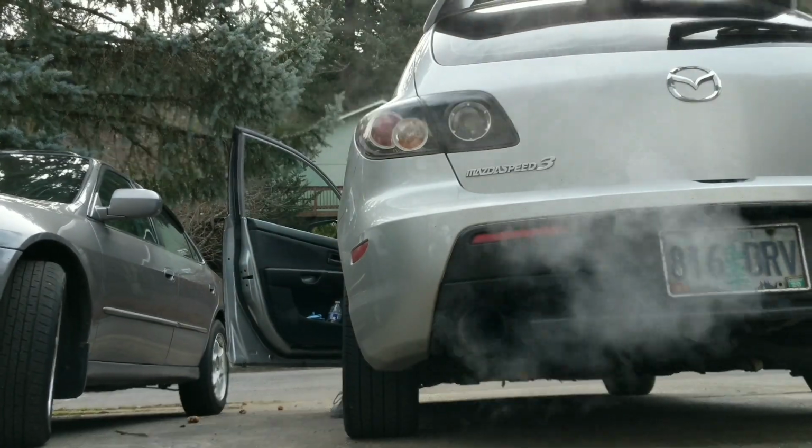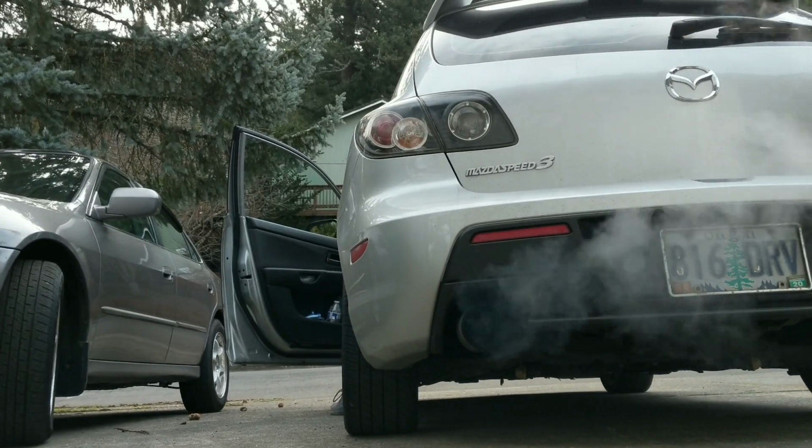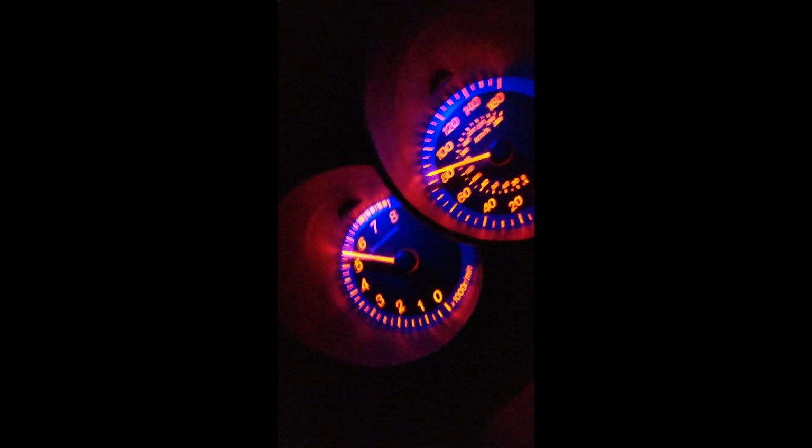And so this is just a video to show the process of going through and figuring out all of this on my own for the first time and figuring out how to rebuild the motor. At first I thought I was just gonna have to change the rings and do stuff like that, but what it came down to is the cylinders were actually not round anymore.